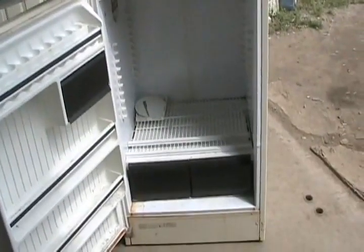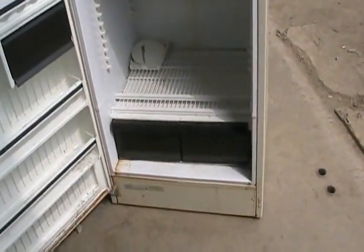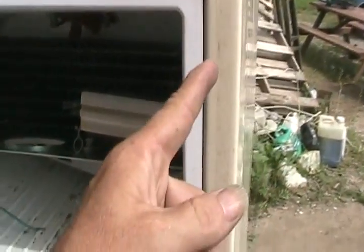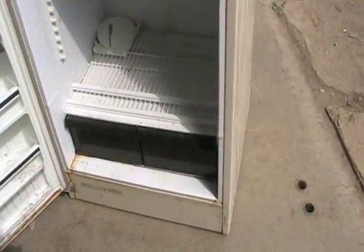Some fridges' door frames get too cold and because of that they start to rust and drip. So this is a way of using some waste heat from the compressor to warm up the door frame without using any electricity. The disadvantage is that air often gets into that space — there's often fiberglass insulation in the walls — and that gets the insulation moist, which rusts out this tube somewhere around the door frame. That's one of the most common places where fridges will leak Freon, and you usually won't be able to find or repair the leak, so you have to throw it away.